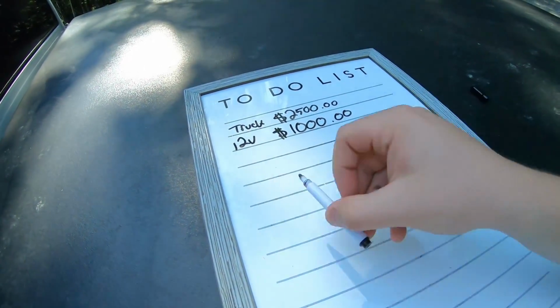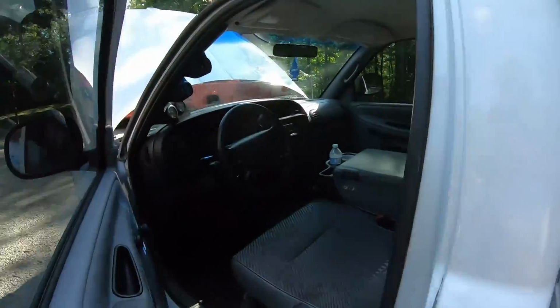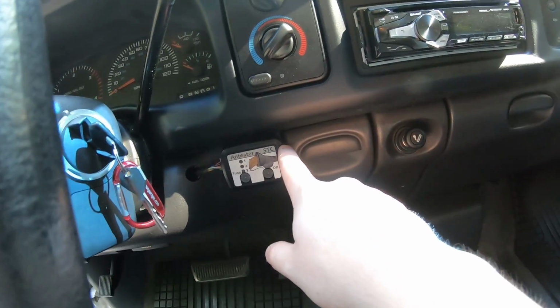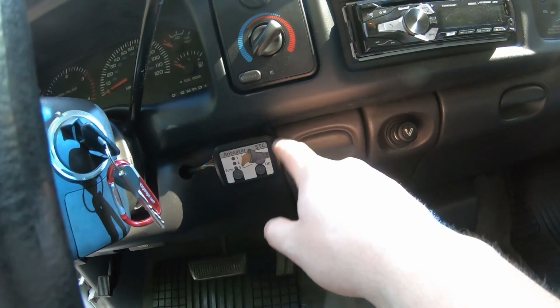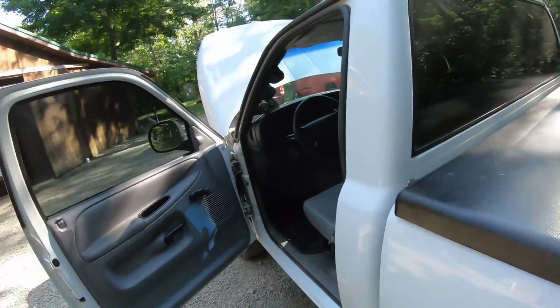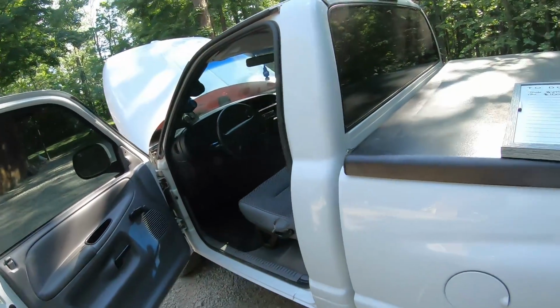Okay, we needed a transmission for it. It is running the 47RE with a Fire Punk Anteater controller. These are super awesome. I've been pushing these a lot on the channel. It's not a paid advertisement or anything. I just truly love this product. These anteaters are freaking awesome, and it just basically makes it where you can easily run a 47 or 48RE transmission in a truck, and all it needs is power, ground and the TPS, and that's it. Speed sensor plugs into a couple things.